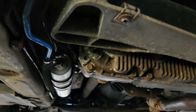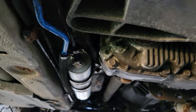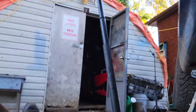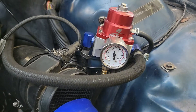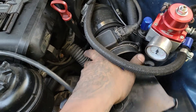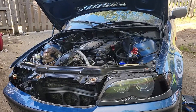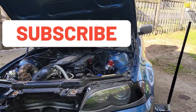By the way, this is way after the fact - I couldn't get my car started and I knew that I'd messed up these lines. So it's blue for the return and black for the in. If you're trying to copy me, do it that way. Anyways, the car is gonna start now, so that's good news. Here it is - everything's working. We have fuel pressure here. My mass airflow sensor isn't even in place, it's just kind of sitting there just to pass some air through it. Engine's not running properly plus it has that blown head gasket, so this is just good enough to move it.